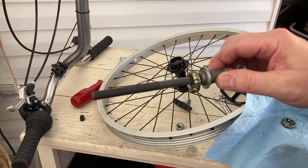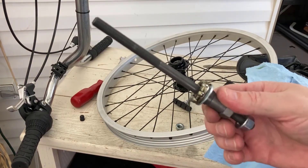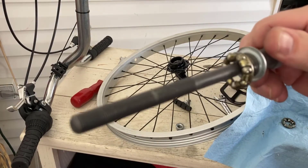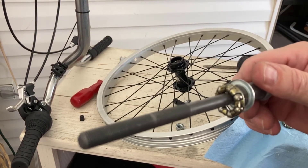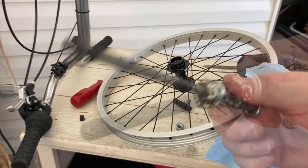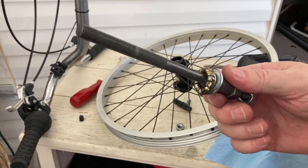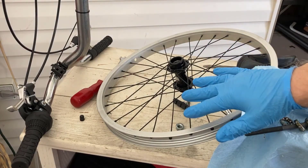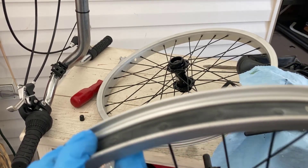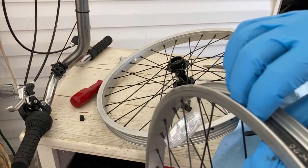Here is another humble opinion: this is the brand new axle I got and it was really tight. When I loosened it up and checked the inside, that's all the grease it has — in my opinion it's not enough. I'm going to grease it up and recommend: always look at something before you put it on, even if it's new. Also, this new wheel did not come with the inner tube protector for the rim — good thing I saw that, otherwise putting it together would not have been a good situation.